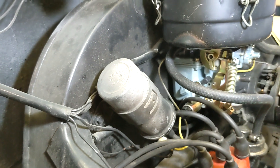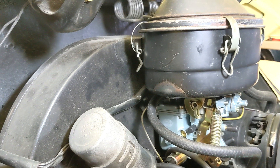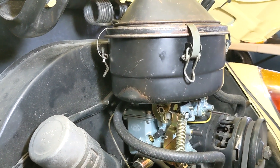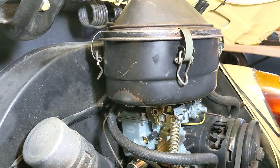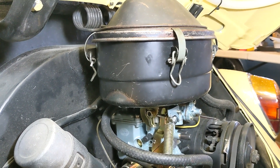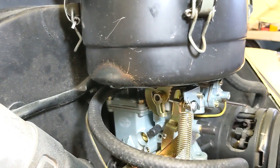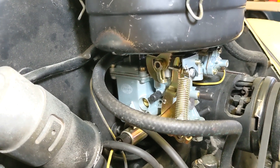I've done that and she's running pretty nice now — the best it has been. Start it cold and pretty much I can drive it straight away down the driveway, where I used to have to warm it up a fair bit. Now I start it cold and basically can drive it off straight away, allowing that choke to do what it needs to do. Changing between gears is really good, and coming down to corners where you drop your revs and then want to take off again is really good. That's how I adjusted my carby using just those couple of screws.